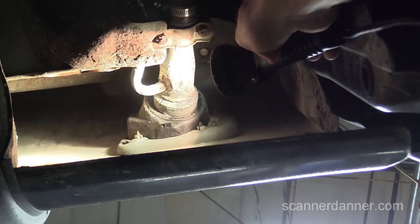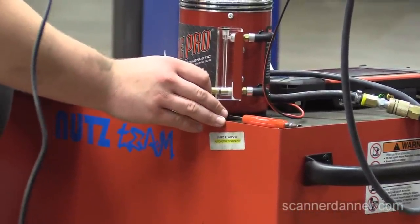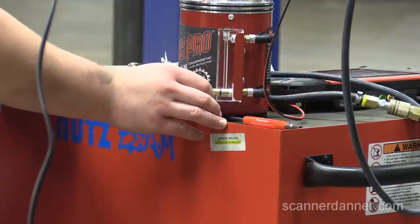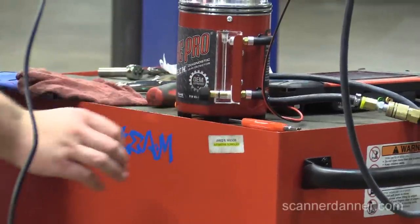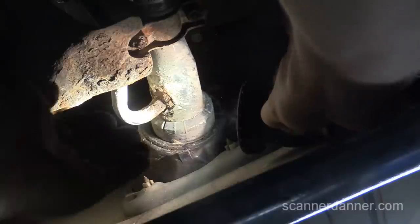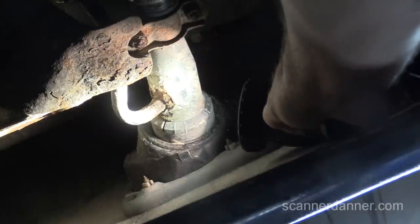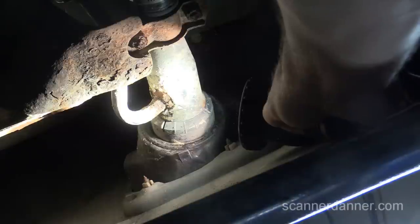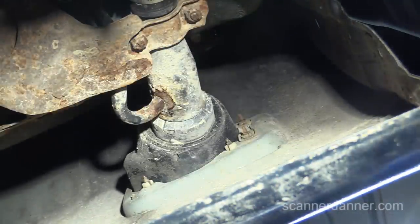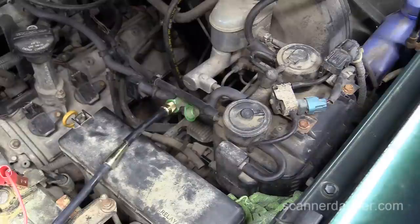It's coming out of the filler neck right here. Turn that dial to make the ball drop about halfway on the gauge — just have it floating in the middle. You will have smoke coming from up there because we never closed the vent. It's coming right out of that filler neck where the vent tube comes out of the side. To be honest, doing a proper leak test typically involves closing the vent off, which we didn't do. This leak was bad enough that we didn't have to. There's your leak — you need a filler neck.